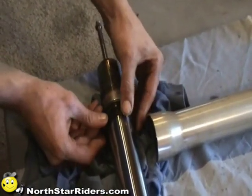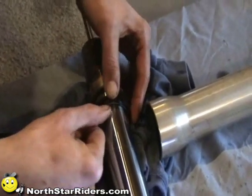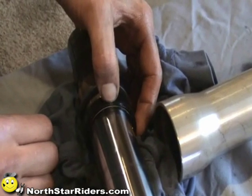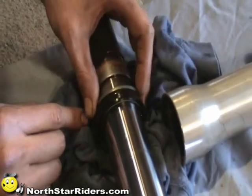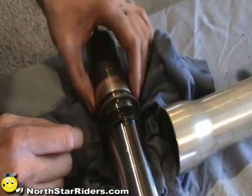It's not. If you look at the outside, it's got little notches on the outside right below my fingernail. That's what tells you the direction of this particular seal. You want this pointing out. The next, you have the washer. This makes sure that the seal doesn't come in contact with the bushing and doesn't harm it.